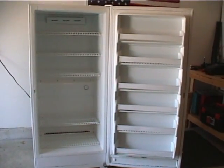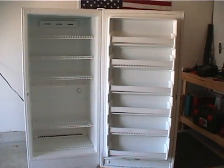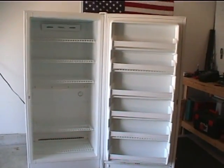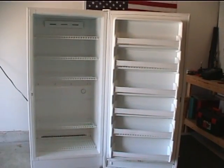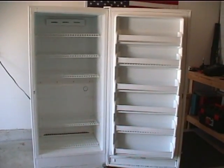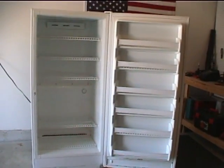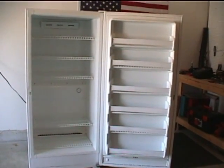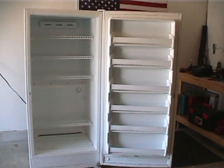It's going to be very simple. Basically, you get your old freezer, wash it up real good, take the compressor out of the bottom. You just have to drill a hole for access for your power cord for the heat tape and run it along the back. Some people run it on the sides — either way works. Then you drill a hole in the top, drop your probe down into the center, and there you go.